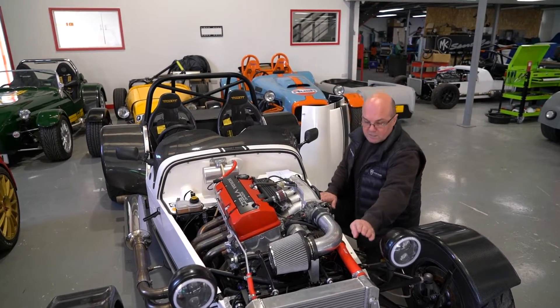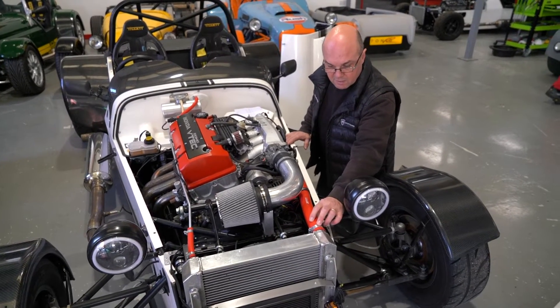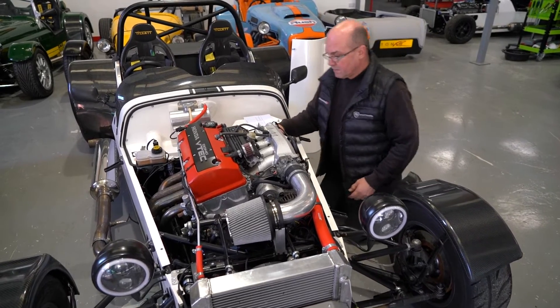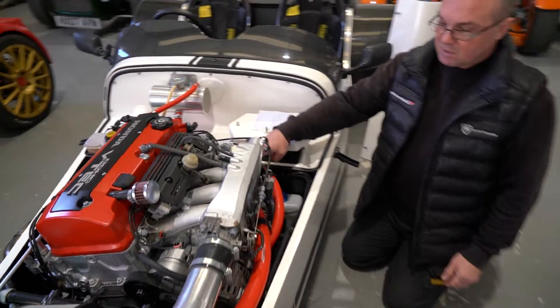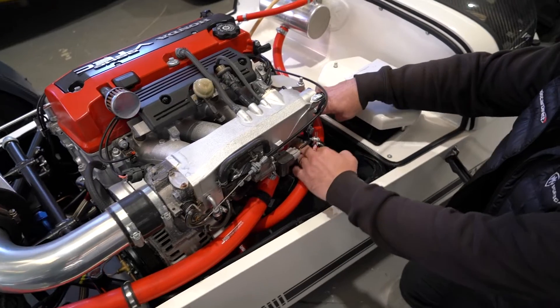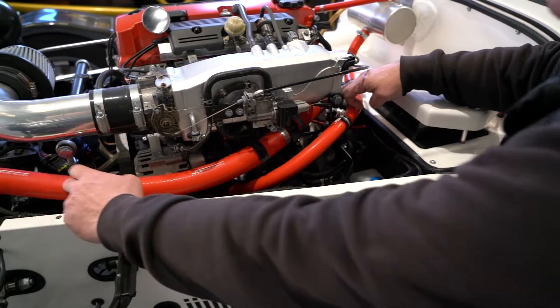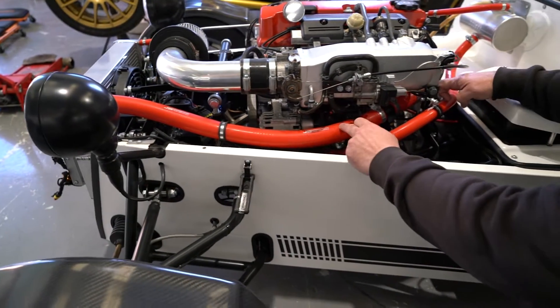You've got a radiator here with your top hose. This is a 32mm outlet here, and then it runs along and joins up. It comes over here and joins up into this top hose. So you've got your top hose at your thermostat housing basically here, and this one joins up to the top of the radiator. That's the hot side of the engine.